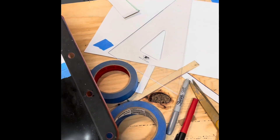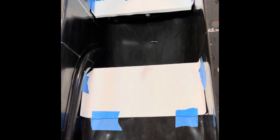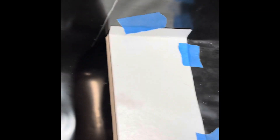With my guidelines in place, the next step was making some cardboard templates, and you really don't want to use corrugated cardboard — it's not accurate enough. I used cardboard stock which I usually find in gasket packaging. I found the back one was a little tricky to make and have it fit nicely. The front one's super simple, and I've got a downturned edge on both sides that stiffens the whole thing and helps with oil control quite a bit.